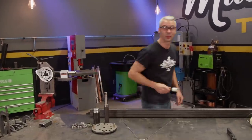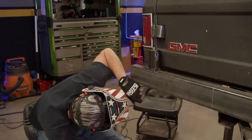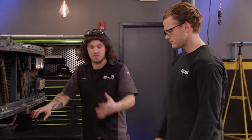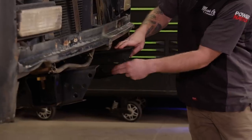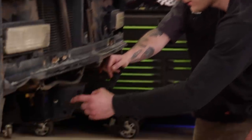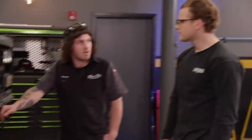One thing on the front bumper is I want to make it removable. That way if you get any damage or whatever, you can fix it. I think we need to take this bracket off - that means cut these four rivets - that way we have a flat surface for the tube to sit on. Something too is if we actually tack the tube in here, we can use these holes as a drill guide. That way we get our bolts and everything to line up perfect.